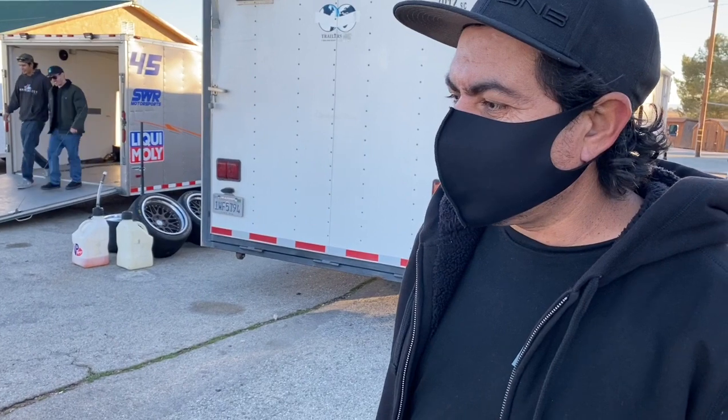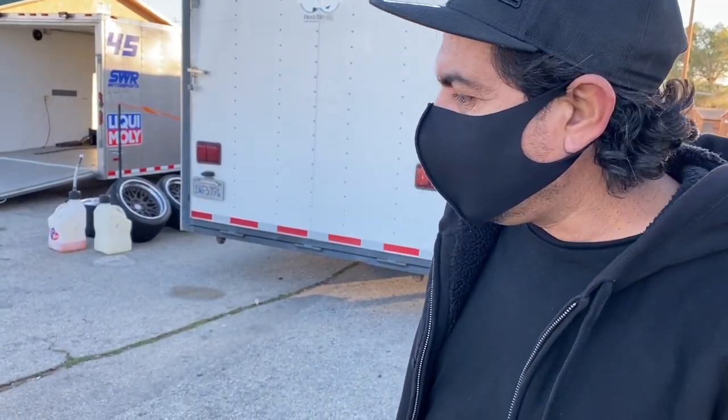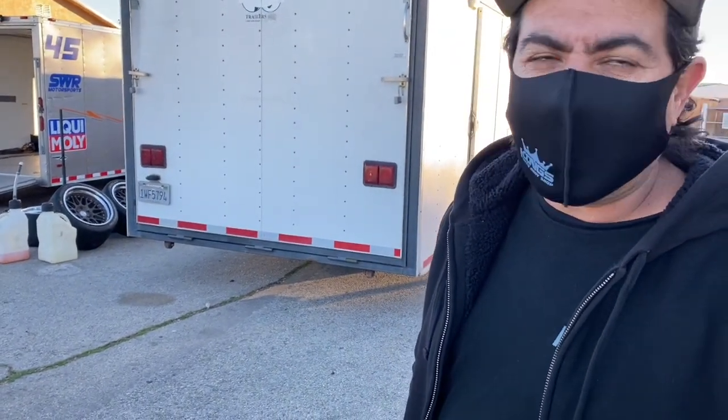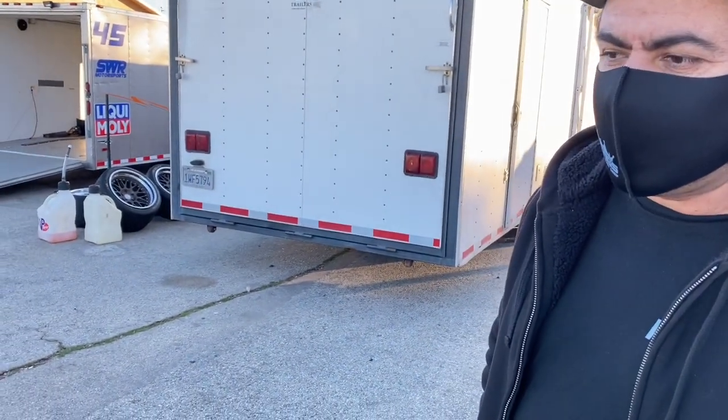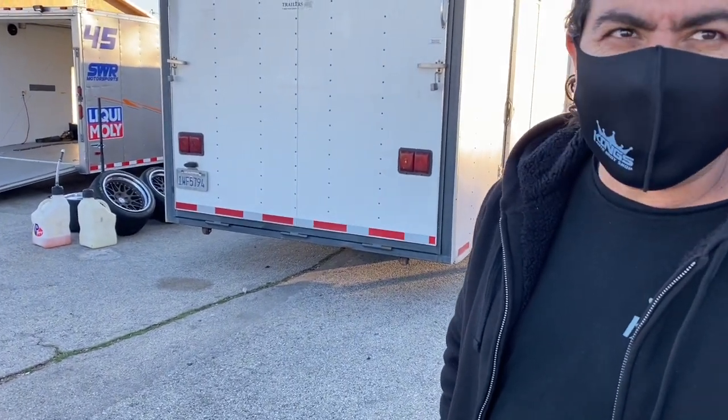The class is very much power to weight ratio. This one is running the 6-cylinder engine, the S54. It's making about 350 horsepower, and it weighs about 3,000 pounds with me in it. Do you have different size tires in the front and the back? Yeah, we're running 285 in the front and 305 in the back. And then you have suspension. We're running the Moton 3-way adjustable suspension.